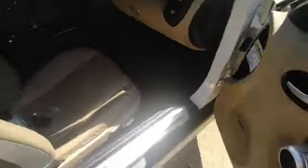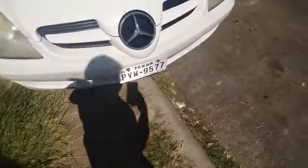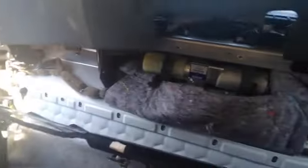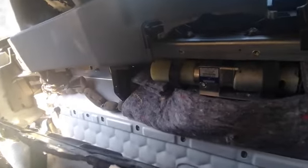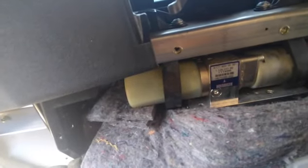Since I don't want to take the pump out, I had to put the vehicle up on a sidewalk curb to give it an incline. I think you can still do a little more incline so the level reads correctly and you can get a lot more oil in there without removing the pump. The vehicle is inclined and I can still inject a lot more oil in there.